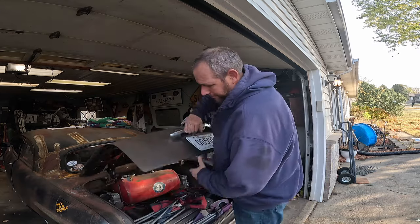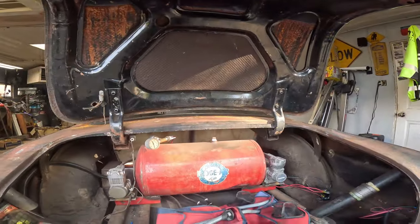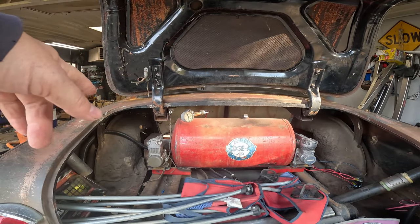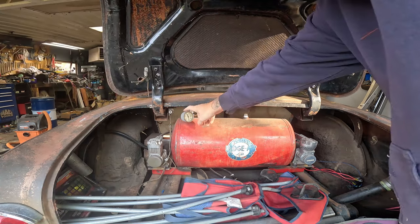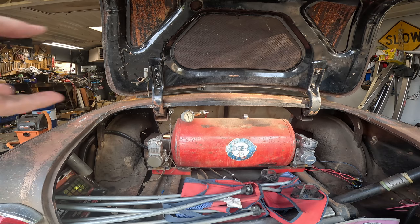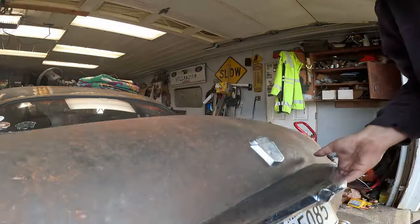After we went through and fixed all our leaks, patched them all up, and made her nice and airtight, we got her put in. And she's in. Plumbed. Everything works. The pump's right where I was going to put them. It's bolted down to the frame like I originally was, and then you can see that same original air gauge for the compressor is still on there. It must have a leak somewhere in the system, though, because she always leaks down to about 40 PSI. Why that is, we'll figure it out.